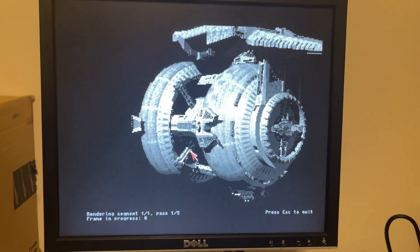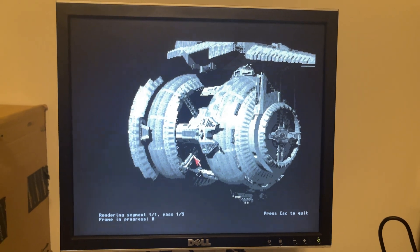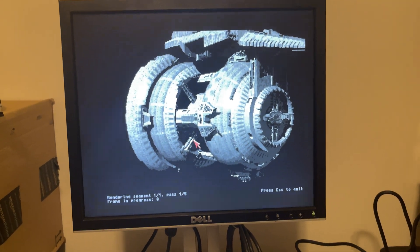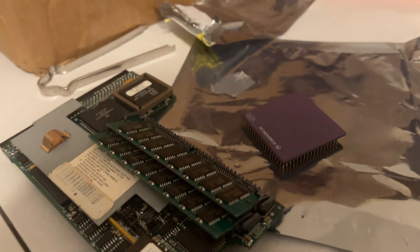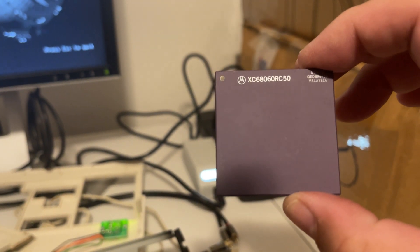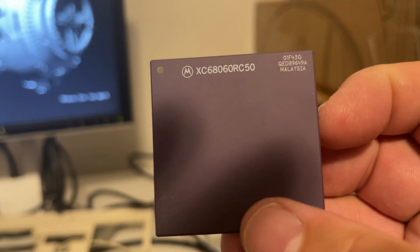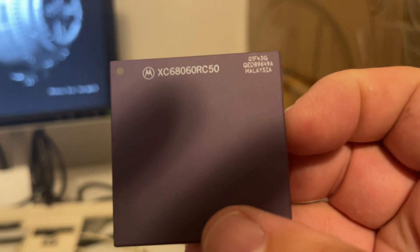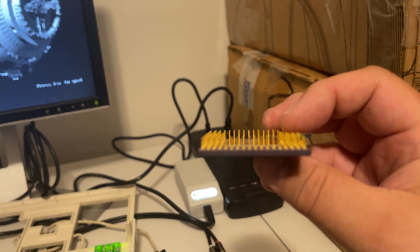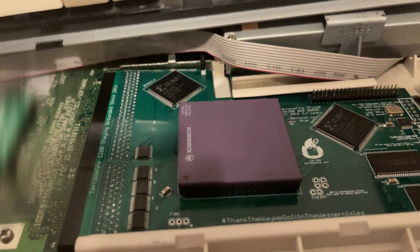It's cooking — it's booking! I am so happy. That last video I was so depressed, but not to the point of throwing this Amiga out the window. As I said, I don't give up — it's always a challenge with Amigas. What this means is that the 68060 CPU I got from the fellow in the UK does not work with this card. I noticed the pins were a little weird, and even though I made sure they were seated properly, that one just doesn't work.